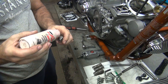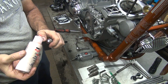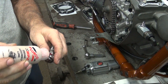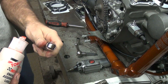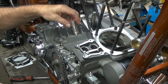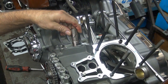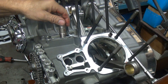So you put a little bit on both sides of that to get some roller lube, then you get your fingers all lubed up too. Look at that — nice work. That did some slimy job there. Do those things have needle bearings in the roller? Yes. Now when you install these, make sure you do not put them in sideways — make sure you put them in the correct direction. You don't rotate them around. That's correct.